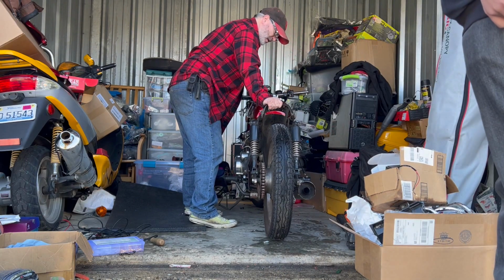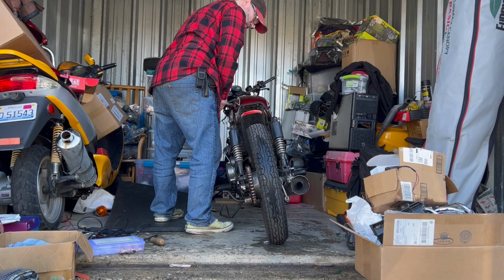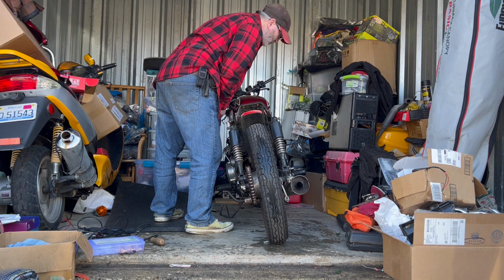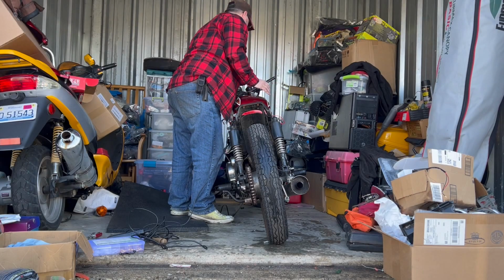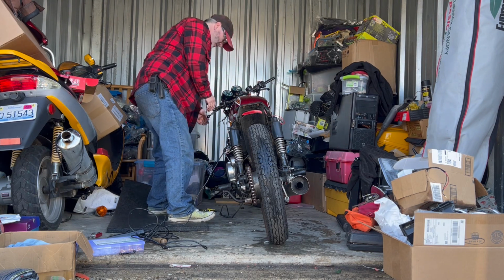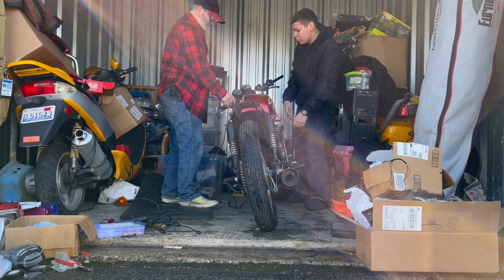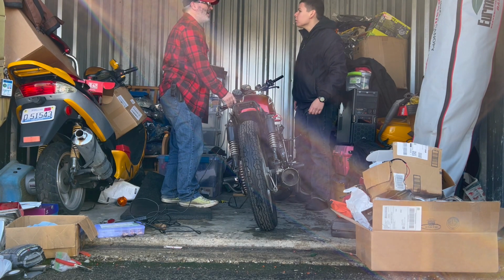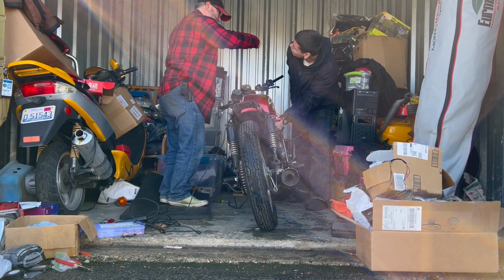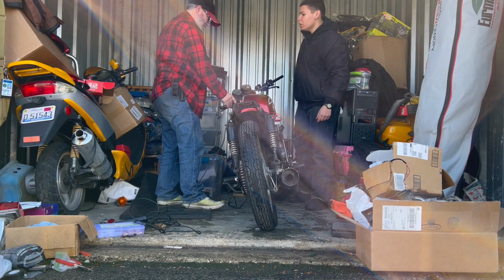Okay. Bike's definitely in neutral. Yeah. That's important. Oh, it's because it wasn't on run. Okay, so that should be a trooper now. Oh wow, there we are. It was idle too low. Turn it up a little bit more. Up is up, right? Clockwise, screwing it in, is idle up, right? I think so. Let's try it.